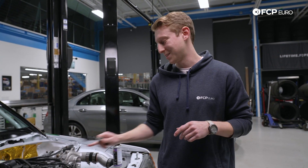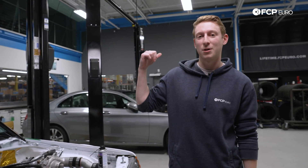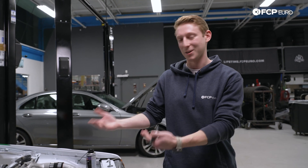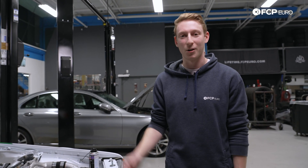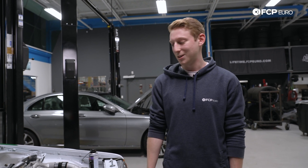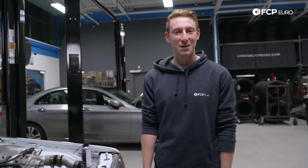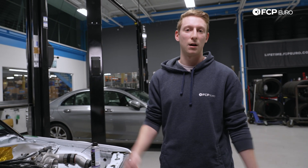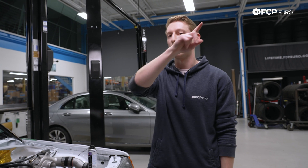The M256 straight-six does the same thing as well. We'll head over to our C300 just to show you what it looks like when it's not in a race car format — but it's kind of all copy and paste. If you have an E10 socket and a ratchet, you can do this in 10 to 15 minutes. Anyone can do it, and it's going to save you thousands of dollars down the line if you do end up having oil going up into the harness.